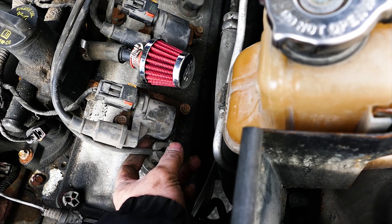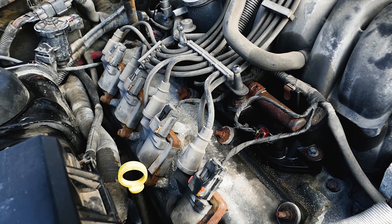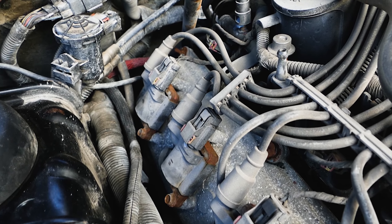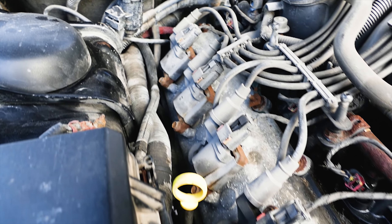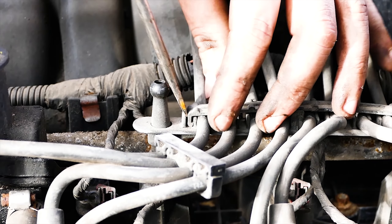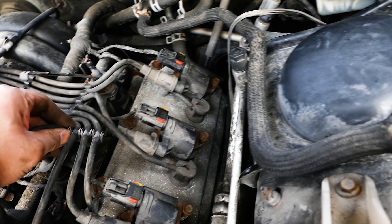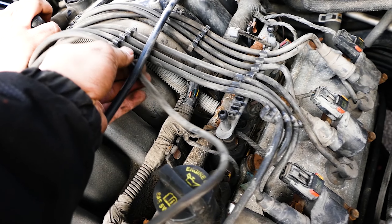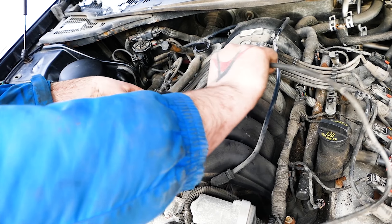Locate one spark plug wire that is connected to a spark plug. A spark plug wire in the Hemi is connected to one spark plug on one end and connected to a corresponding ignition coil on the other side of the Hemi. It is important to do this one spark plug wire at a time to keep things simple and not mix up the spark plug wire locations, which will mess up the firing order. Now let's remove the spark plug wire up and out of the way. Let's follow the wire until we hit one plastic retaining clip set. Then grab the flathead screwdriver and crack open the retaining clip set so that we can remove the spark plug wire out of its retaining clip seat. Keep following the spark plug wire and repeat the process of cracking the retaining clips when we encounter them, until we hit the end of the spark plug wire which is connected to its corresponding ignition coil on the other side of the Hemi. Next, pull the end of the spark plug wire out of the ignition coil.